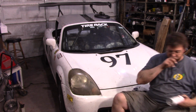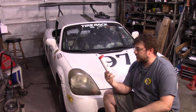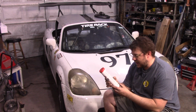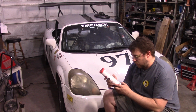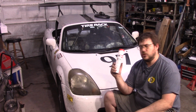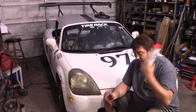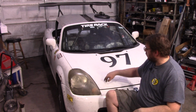And then the other thing I'm hoping for is that the people at the drive shaft shop didn't steer me wrong, and that this Redline CV2 grease here claims to be usable up to 500 degrees Fahrenheit, but the drop point for this grease is 800 degrees Fahrenheit, which is ludicrous. That genuinely doesn't make sense to me, but that's what it is. So if that's the case, if they're not lying on that, then that should solve this problem. So anyways, I should get back to the race prep for this.